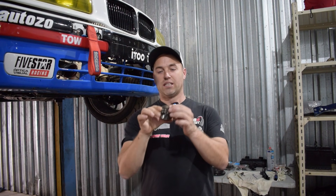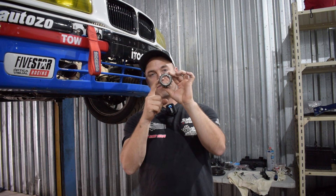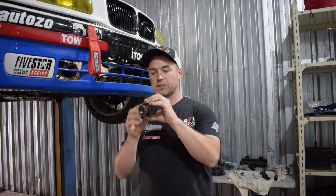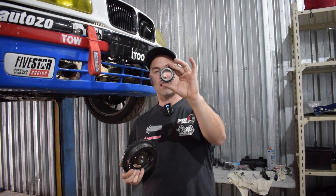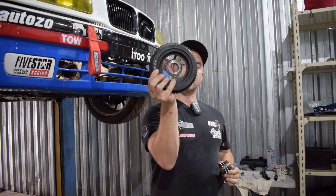I didn't go that route. What I did is I went to a friend who helps me with a lot of engineering work and we machined down each one of the sprockets — we machined the diameter on the sprocket by half a millimeter, still giving it a very tight close tolerance. You still push it on but it's quite tight, because you don't want the sprocket to move around at all. So I machined this down by 0.5 millimeters and I machined the dynamic balancer pulley down by 0.5 millimeters.